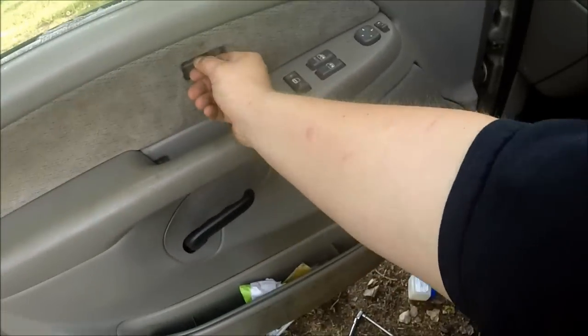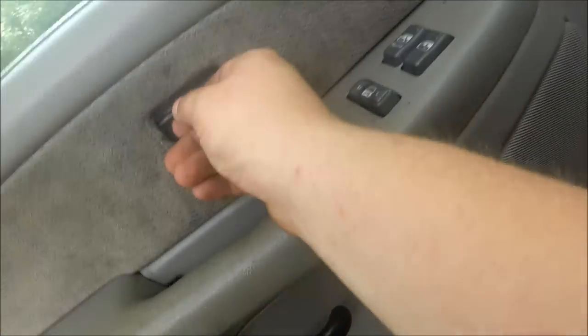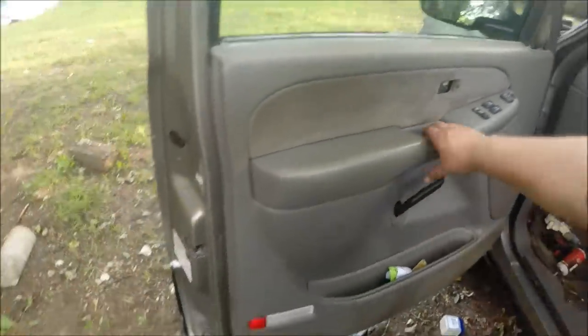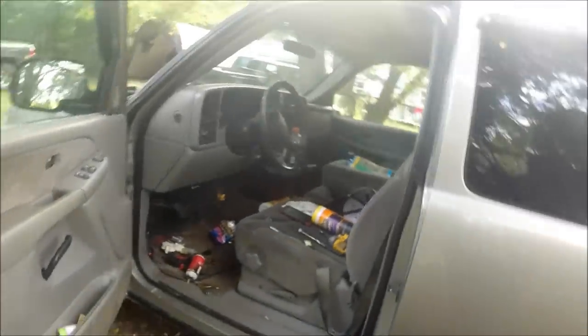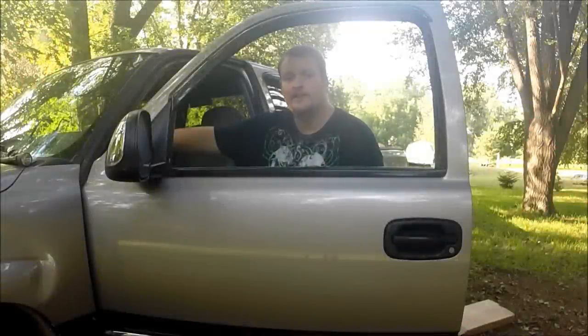You can see I'm missing my lock indicators. A lot of times these actually get bent when you take them off, so make sure they are free flowing before you shut your door — because you might not be able to unlock it. And that is your door; that is the window regulator replaced. I'm Joe the Autoguy — thanks for watching this video, hope it helped. Please like and subscribe. You can also find me on Facebook, Twitter, and Google Plus, and my email's down below.